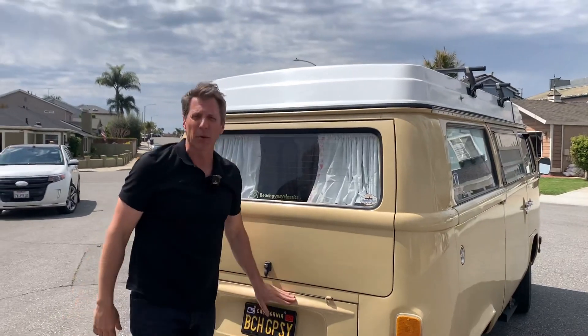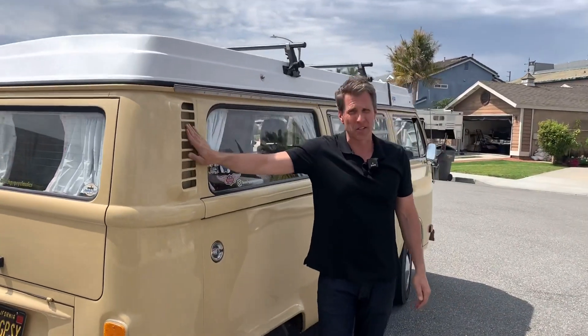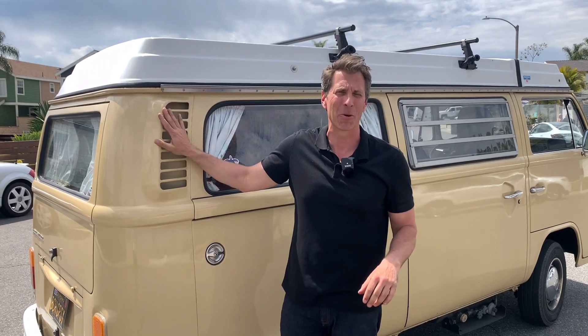One final tip: if you've got the bus for a week or so, check the oil about every third fill-up. You can tell if you're driving it too hot because all you have to do is touch the dipstick — if it's too hot to touch, you're driving too fast, but it almost never happens. These over here are the air fins — they bring the air in down over the engine and cool it. We had somebody wrap the bus for HBO and they covered this up and couldn't figure out why it was overheating. So make sure these fins are not clogged up or have anything over them. Thanks — we hope you have a great time and enjoy our bus.